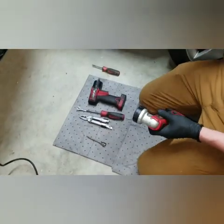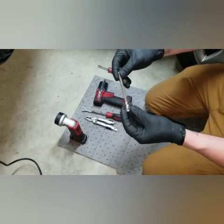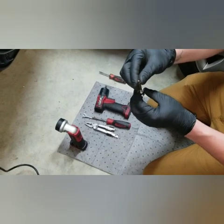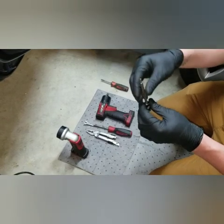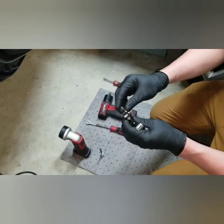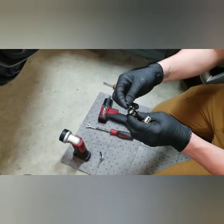So some of the tools you're going to want to work with here: good flashlight. All right, I got one up above there too. That'll give us some more light on the door. You're going to want a T20 Torx bit. Doesn't need to be tamper-proof. That's just the type that I have. So it's going to be that 6-point star T20. That's the size that's going to take the screws out of the door once we get some of these little access panels off.